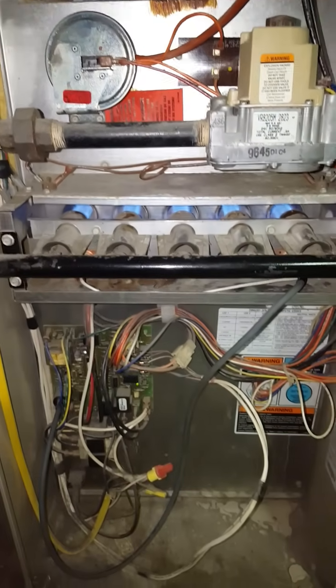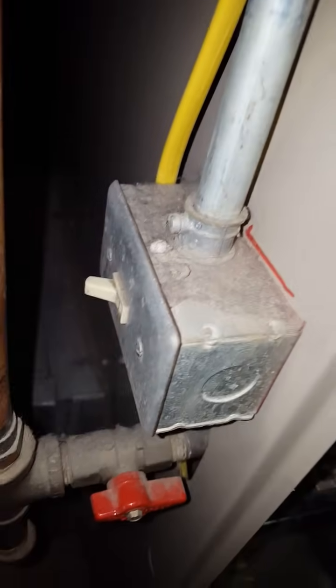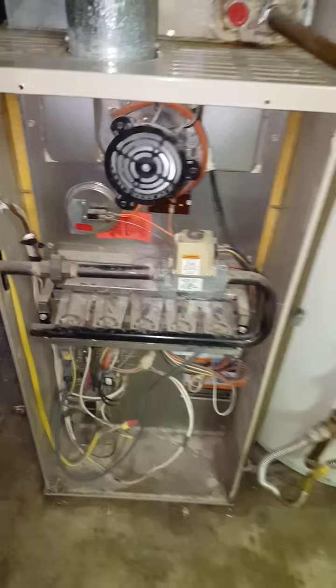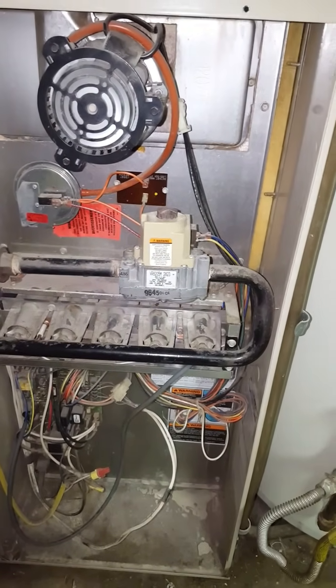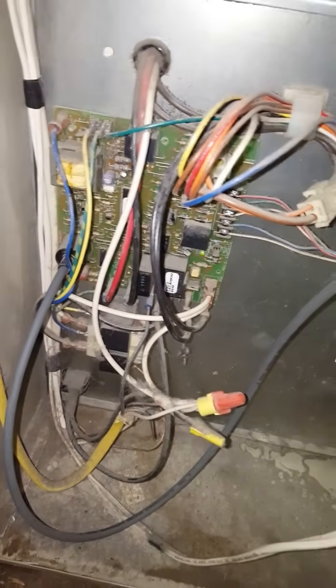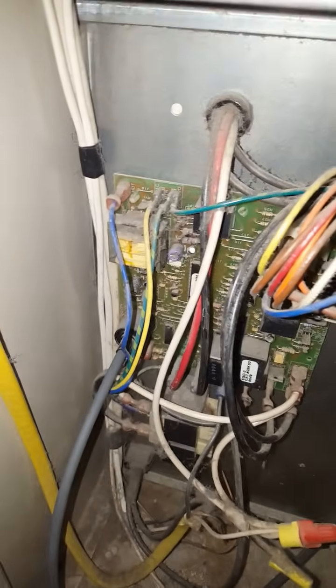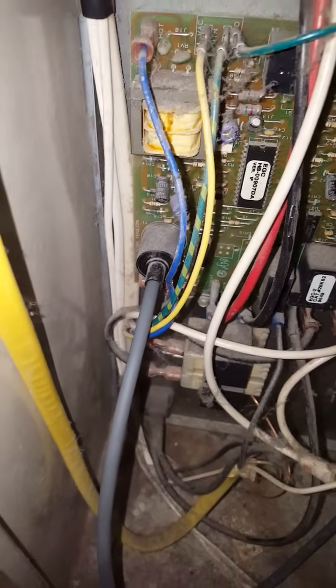I was racking my brain trying to figure out what was wrong with this, why it wouldn't start. You have a power switch over here — first thing you ever want to do is turn that power switch off. Finally, after three days, I took this cable off right here from the spark igniter because I realized I'm not getting any spark at all. I figured the only thing it could be was this cable. I took that gray cable off — just like a spark plug cable — and this end has a metal plug, and this end down here just pushes into that black thing connected to the controller. I took it out and made a fresh cut on it, then put it back in.